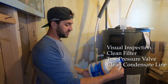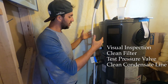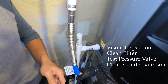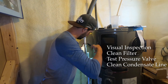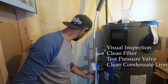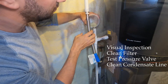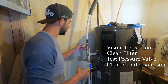For this next step you need bleach. Hybrid heat pump water heaters create a lot of condensate by pulling humidity out of the air, which dumps into the condensate line and the pump sends it away. Open up the drain line access, give it a visual inspection to make sure nothing is blocking it, then pour about a cup of bleach in. That will eat away any sediment or buildup. Do this once a year, put the cap back on, and let it sit overnight to wash through the system.